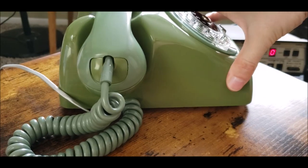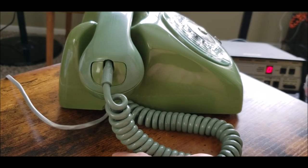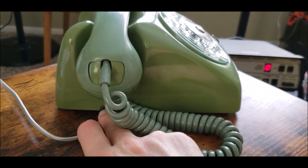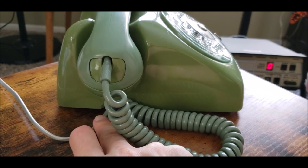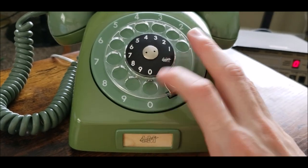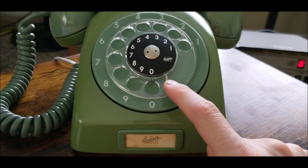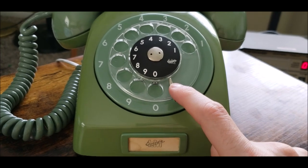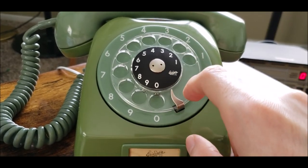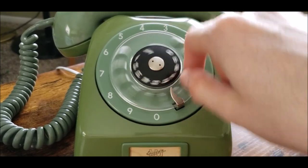Here's the other side. There was no line cord equipped with this phone when I got it either. I put a modular port on the inside — this is a three-spade cord with the RJ11. The dial isn't sounding great. One thing I noticed is that there wasn't very much resistance to this dial when you wind it up, so I turned the spring a few times. It now feels like the same resistance as my other Ericsson and non-Ericsson Dialogue telephones — it felt a little too loose before, but it feels perfect now.